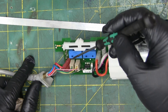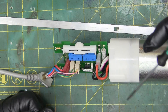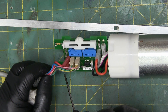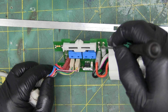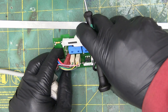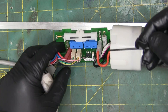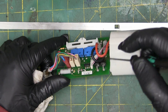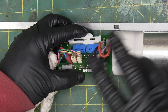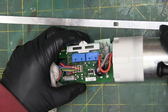Here are the brains of the operation. Unfortunately we can see there are no Hall effect sensors installed — those would be great because they'd be pulsing the whole time, telling you exactly your position as long as you kept track of the pulses. We've got some big beefy resistors here: 2R2, so very low resistance — probably just current limiting. The Slim Jim actuates on these two momentary switches, opening the circuit to prevent over-travel. And there are a couple of diodes so that current can go one way, but as soon as you actuate it stops; if you swap the polarity, it can go through the diode to run in reverse.